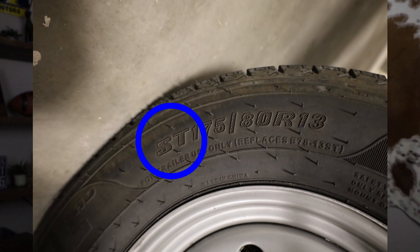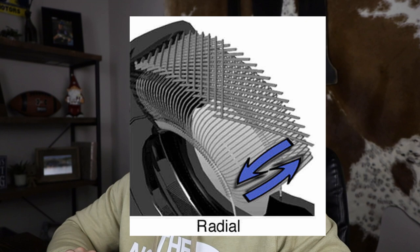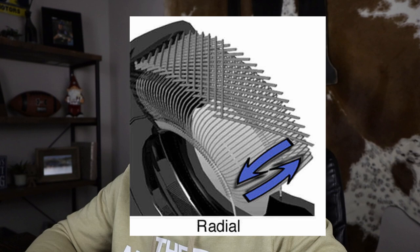Some people say ST stands for 'special tire' or 'special trailer' — either way, ST is a trailer tire. The next subject is a bit longer: radial ply tires versus bias ply tires. Since radial tires are the standard nowadays, let's talk about those first. I'm going to throw up an image of both radial and bias ply tires. Looking at the radial tire, you can see the arrows pointing at the cords going radially across the tire, and you can see the belt ply right on top of it going in a crisscross — that's a steel belt.